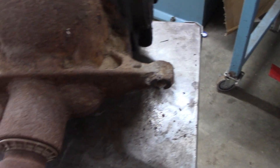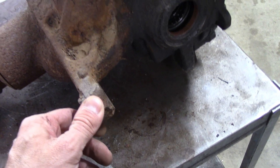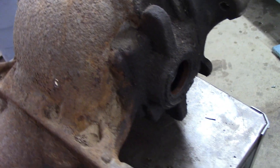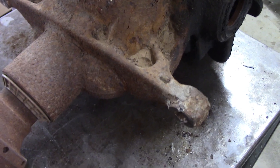I need to re-gear the rear differential to match the front, but while it's out I want to do something about the housing. I'm going to put new seals in it — it was leaking a little bit. The non-GT350s in the '15 to '17s didn't paint the iron differential, and it really got pummeled — there's just rust flaking off of it. So I'm going to do the whole wire wheel thing while it's still together so you don't get dirt inside, and then coat it with POR-15, just like the front diff, which turned out beautiful. I'm not going to show the whole process, but I wanted to show the before so you can get an idea of how crusty this thing was.